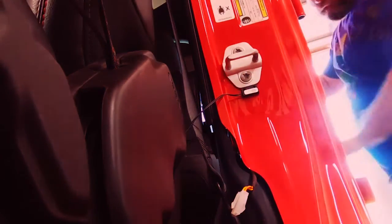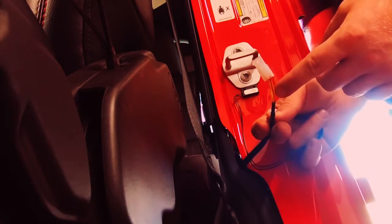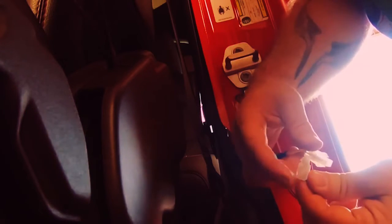The front driver's door uses the connector with the yellow and orange wiring. Put a little dielectric grease inside the female end, then line up the retainment spring on one side with the notch on the other and snap it together. There's an alignment notch and a retainment click, so it's easy to connect properly.